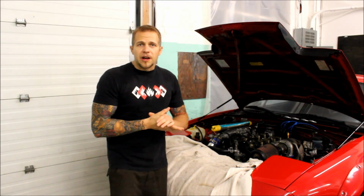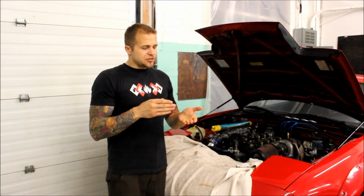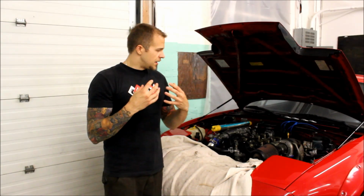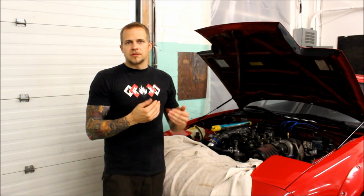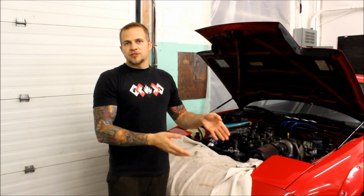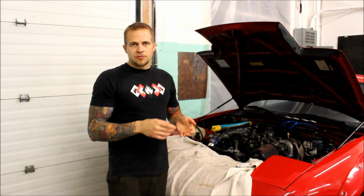So a couple things to know as you're reassembling. Make sure you lubricate thoroughly all the lifters and spring components. You want to have good lubrication for your first startup. Put your cams back in, put your cam caps on, torque them in sequence to 10 foot-pounds, and while you have your covers and everything off, change any oil seals that you need to, retime your engine, put your covers back on, and fire her up.